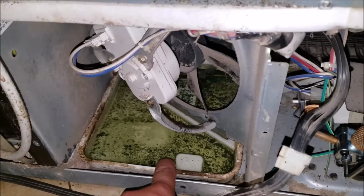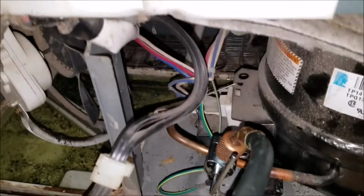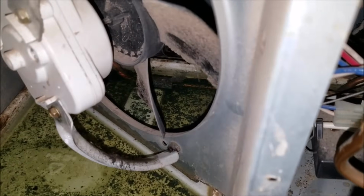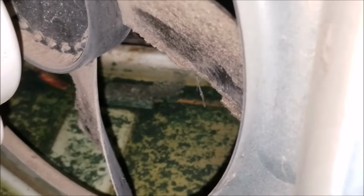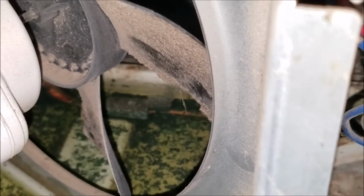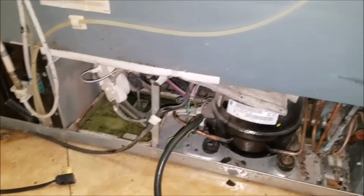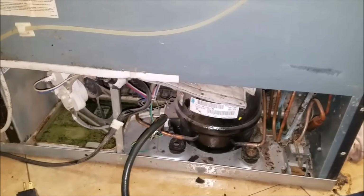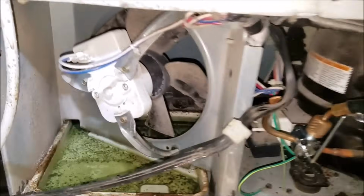This is something that I came up with not too long ago. It's easier if you fill up the drain pan with water, put the nitrogen and then just check. That's the first pipe you want to check, if you have the model where this copper line goes inside the drain pan. The first place you've got to check is that one. You can either fill up the drain pan with water or get a cup or something with soap and go through the first line right there.